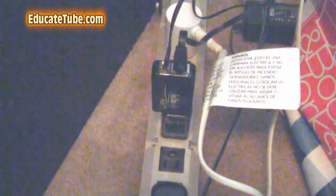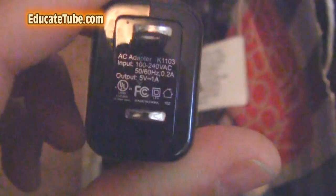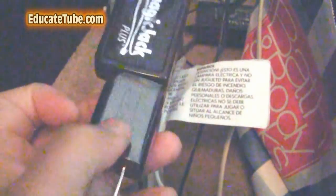Normally, there'll be a green light and a yellow flashing light. Something's happening, and I think it most likely has to do with the power supply. This part here — you need to replace this part. It's most likely not the main unit. So, this power adapter — you have to be careful, you have to look at it — it actually needs an output of 5 volt and 1 amp. It's running on 5 watt power. This one is actually not working.